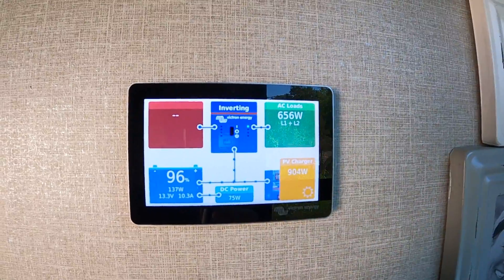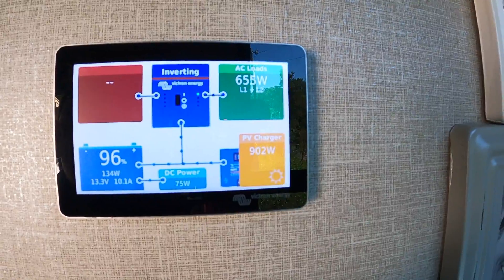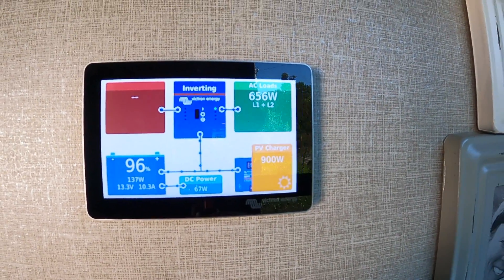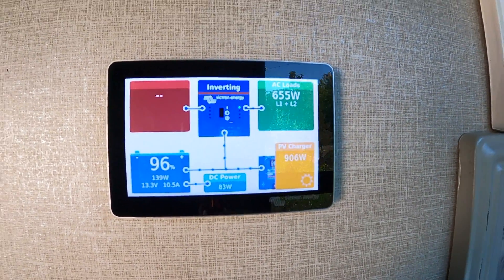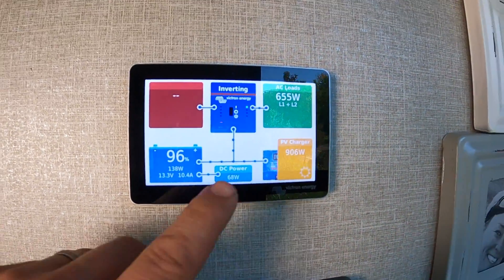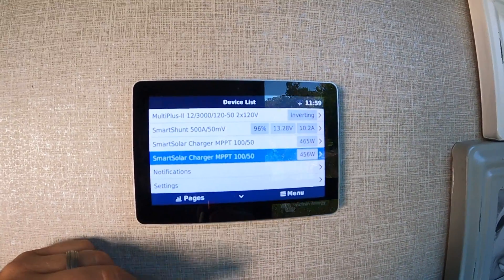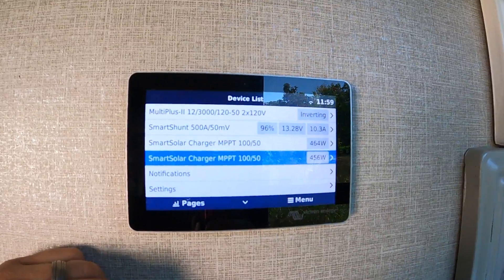Net into the battery is only 10 amps because these absorption fridges are not efficient at all — basically a heater that's on all the time and never shuts off, pulling almost four to five kilowatt-hours a day. A residential refrigerator would use maybe a third to a quarter of that power and cycle off about 60 to 70 percent of the time. It's ridiculous. We're peaking around 900 watts and solar noon isn't for another hour because of daylight saving time.